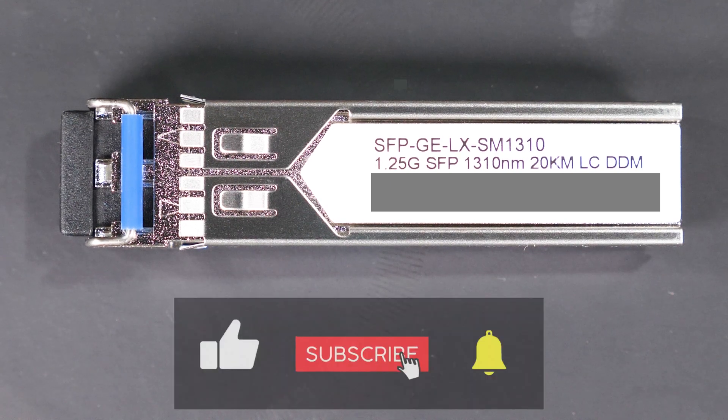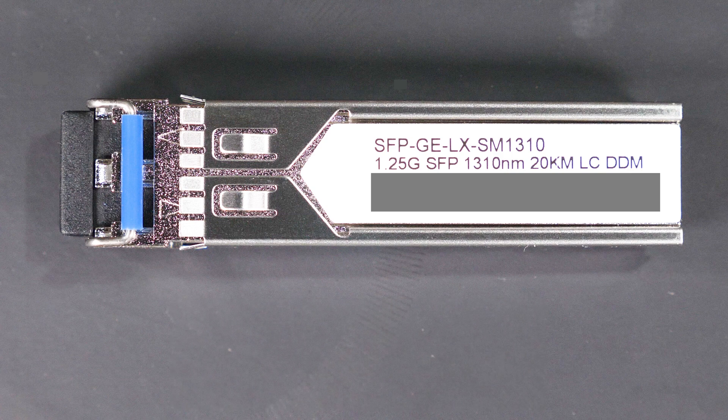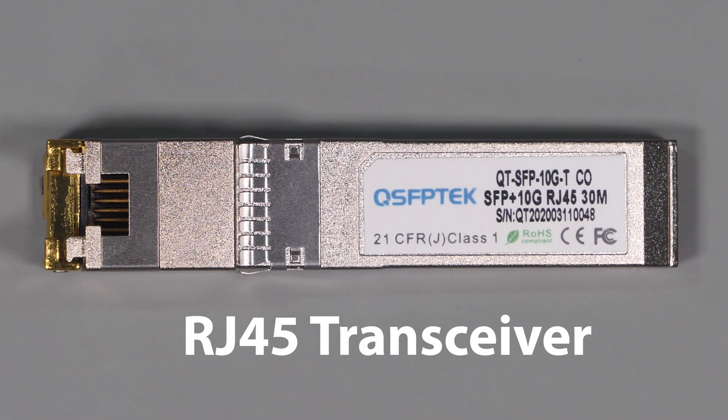As this is only Wi-Fi 6, speed is not impacted, but I did want to point that out in the event that you were looking for a 10 gigabit. I did reach out to Adelove to ask why it was labeled 2.5G as there currently are no 2.5G fiber transceivers that I'm aware of. They explained that there is support for 2.5G but only when using certain RJ45 transceivers — I wasn't able to verify this. Either way, this is an odd combination and Wi-Fi 6 can't really saturate a 1 gig connection anyway, and you actually lose range by using an RJ45 transceiver. I'd just stick with either a dedicated 1 gig port or the long range SFP fiber module. It's a bit confusing but doesn't detract from the usability of the device.